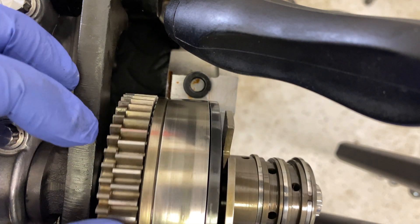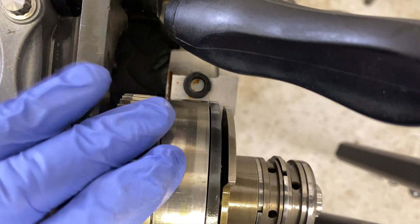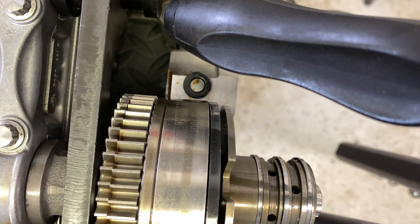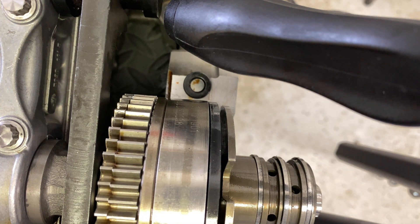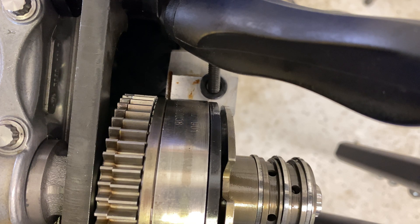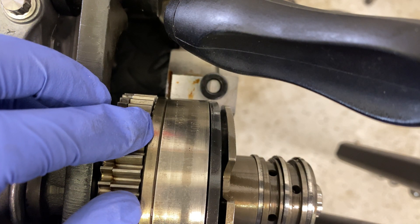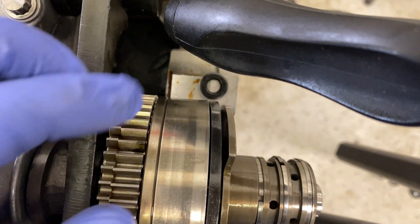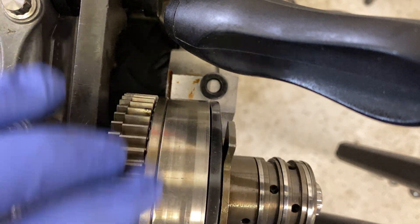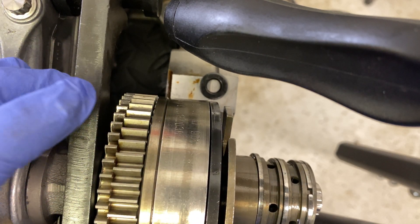All right, here's a video on testing and checking out how everything is lined up. We're going to move one thing over just because it'll be easier and more obvious to see for everybody. Pay attention to that space in between the front cover and the washer — you see how it gets close, goes far away, gets close, gets far away. That's how you do that check.